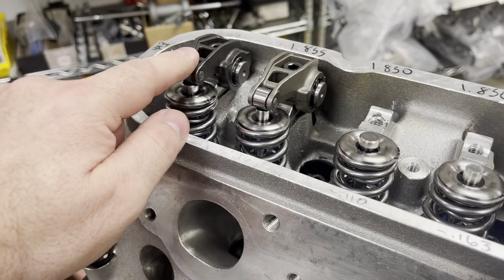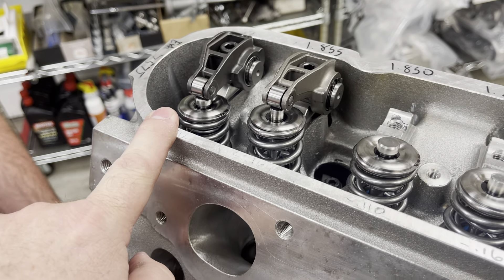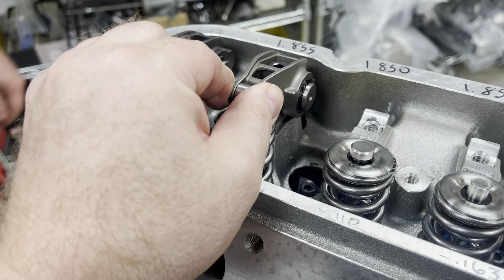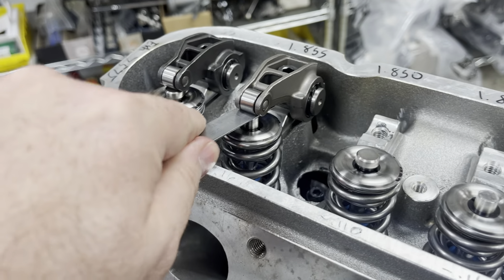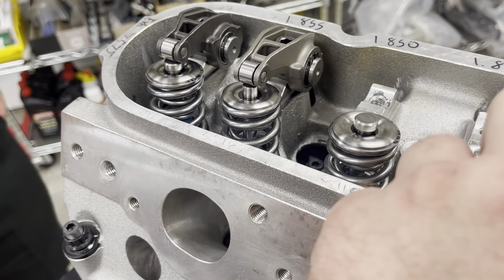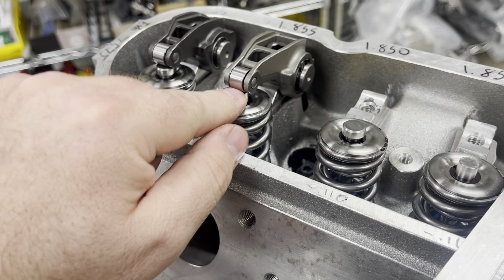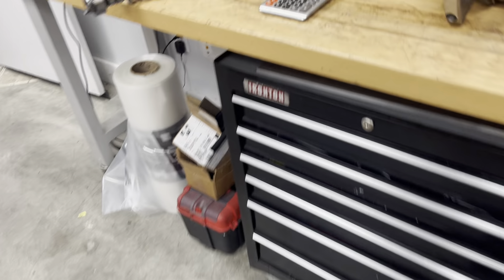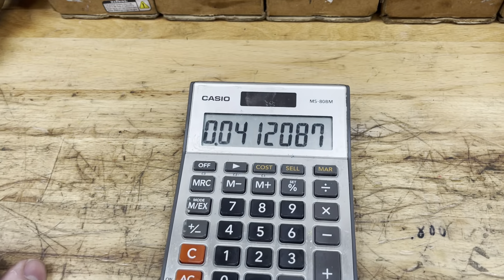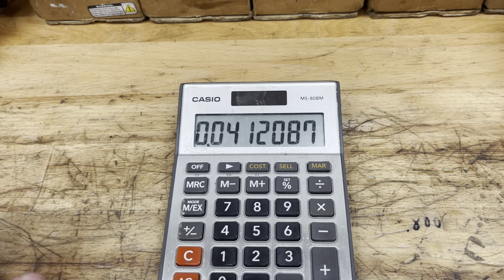If you're running a factory lifter with 200 thousandths of travel and you preload it 180 thousandths, that's too much. Now we've checked our intake, so we need to check the exhaust. We watch this valve open, come all the way back up, the intake just starts — we're in overlap. I wait for the intake to come almost all the way closed before checking the exhaust. For example, say we had 75 thousandths of feeler gauge under there: 0.075 divided by 1.82 equals 41 thousandths off the bottom. We could go at least 25 thousandths longer on that push rod and be just fine.